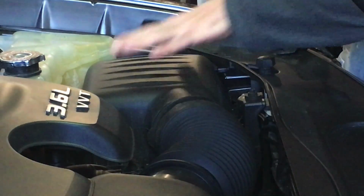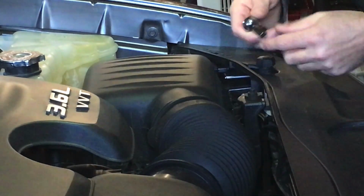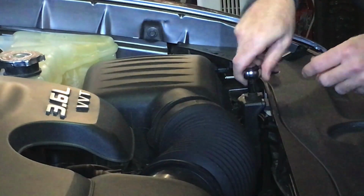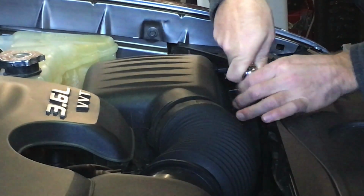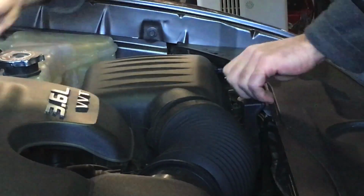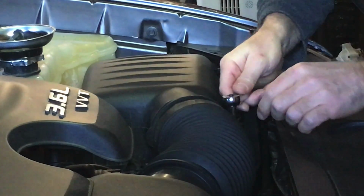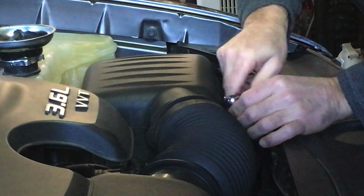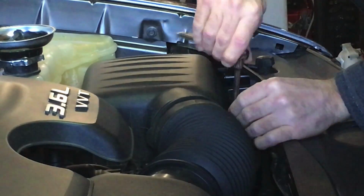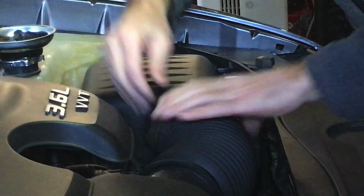Okay, so the first thing I'm going to have to do is get the air box out of here. And I want to remove as little as possible, just enough that I can get my hand in. So I got here a size 5/16, on a little 1/2-inch drive, so we're going to take that off. Another 5/16 drive here. I'll take the boot off. I think that'll help give me a little bit more accessibility. That doesn't come off all the way, just loosen that up.